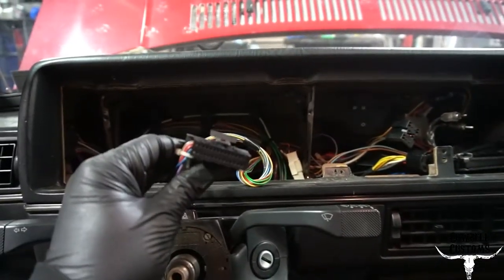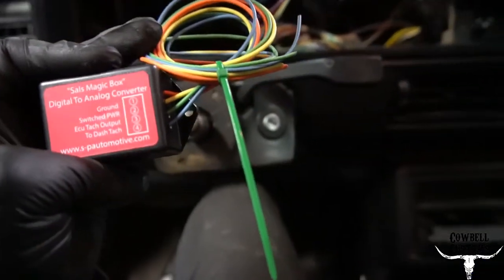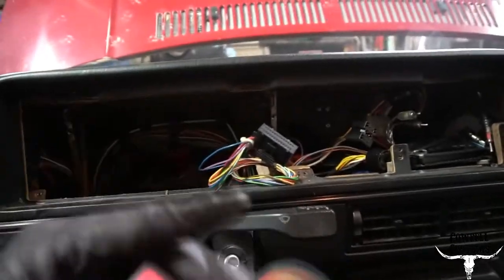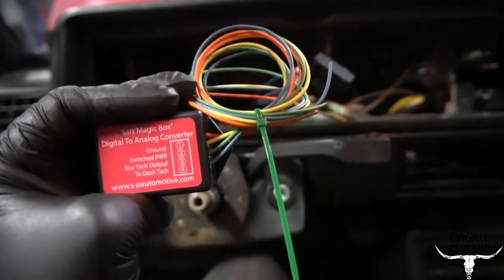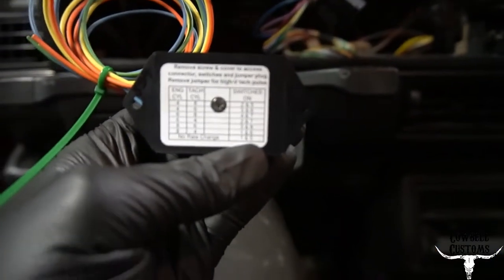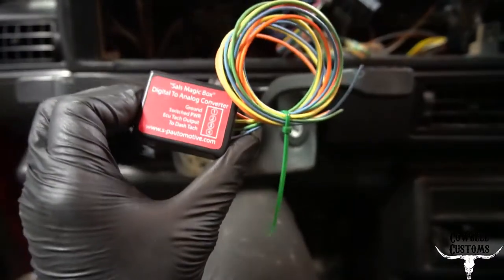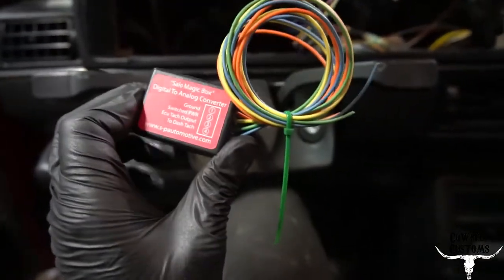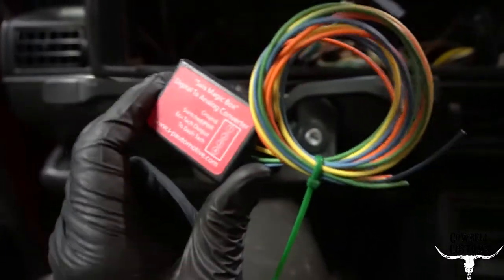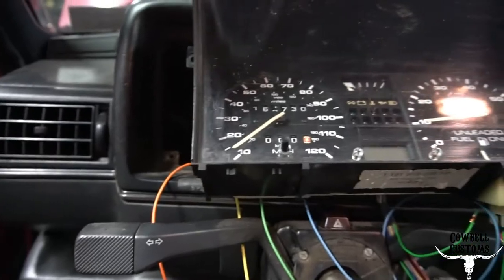While I'm here, I'm debating on tapping into this for tach signal. I don't know who Sal is, but I love his magic box — this thing will allow me to convert the digital tach signal from the VR6 into the analog tach on the Mark 2 cluster. You have to pull it apart and change some switch settings in there, but it's all pretty well explained on the back. This also came from S&P Automotive — check them out, also not sponsored unfortunately.